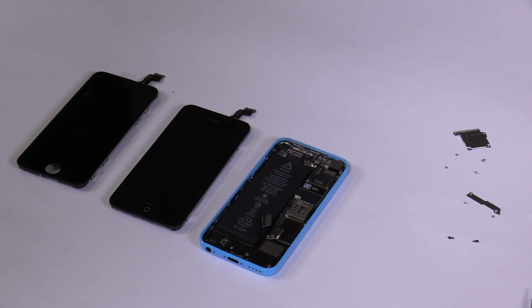If you're experiencing any of these issues, please go back to this step, disconnect your front assembly, and then reconnect it carefully. It's important not to rush it or use too much force, as the sockets on the motherboard can be damaged. Once again, we'll show the correct technique to connect the screen further ahead in this video. Let's focus on removing the small parts from the old screen and installing them onto the new unit.